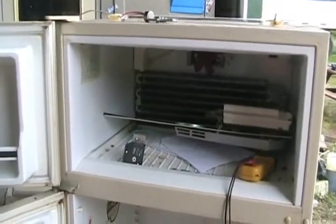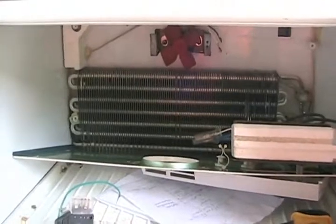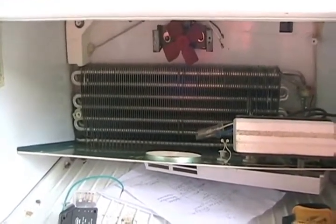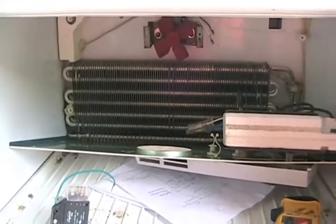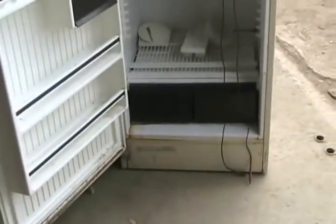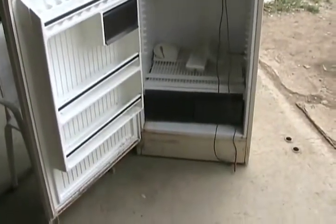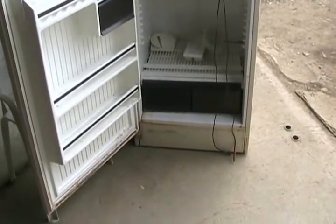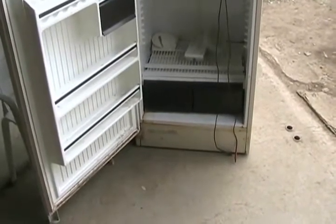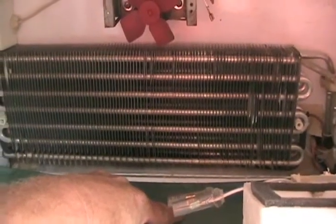If you have a hot air gun or a hair dryer, you can get it all done at the same time just by heating all that up — it won't damage anything — and then you can reassemble everything and it'll work right away. When all that ice does melt, it almost always overflows the drain tray at the back of the fridge that's supposed to catch the water and evaporate it in small amounts at a time. So you'll get a flood on the floor around your fridge — get some towels ready.